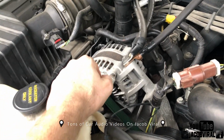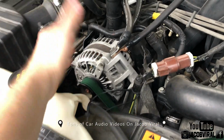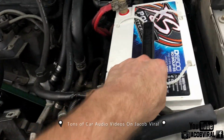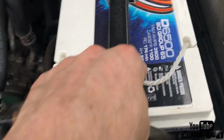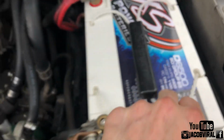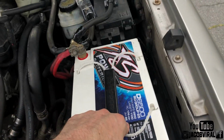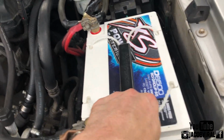So with a 350 amp alt, I assume that my alternator charge supply is also going to support that. So let's just round that up to 900. So 900 watts plus 350 times 10, so 3,500 watts. So I'm right at 3,500 plus 900, so I'm at 4,400 watts. Right now I'm at 4,400 watts.